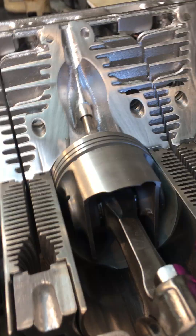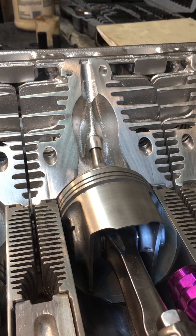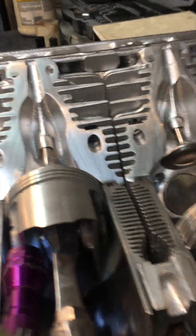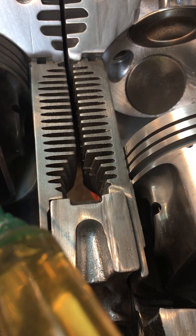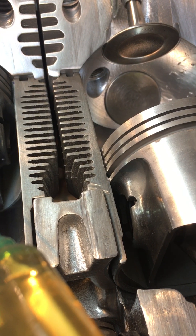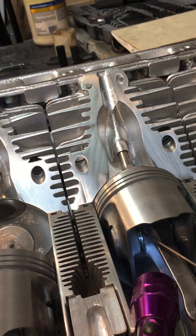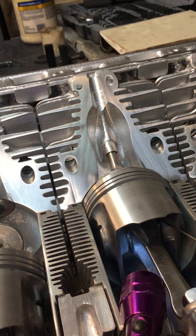For the wrist pins, there are a couple of ways to get oil in there. If you put a light in here, there's actually a hole in the top right there which you could use. Or it's probably just as good to get a couple drops in directly — drop, drop, drop, drop.